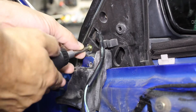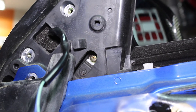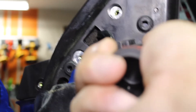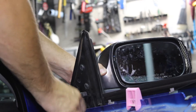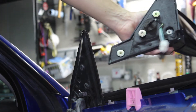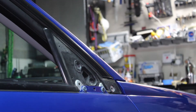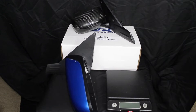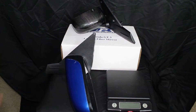There are four Phillips head screws that hold the mirror to its bracket. The fourth one's a little tricky, and you also want to use a magnet to retrieve that bolt because if it falls down inside the door, you're in trouble. Now you can remove the mirror from the outside, snaking the electrical connection through the little hole. And there you have it.